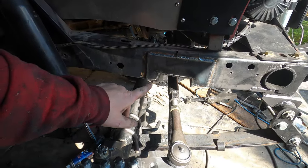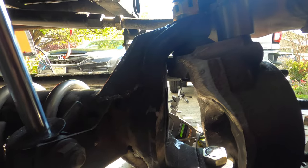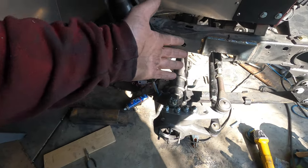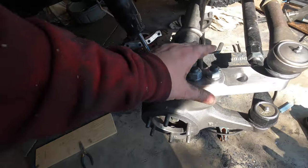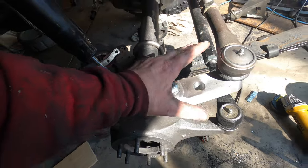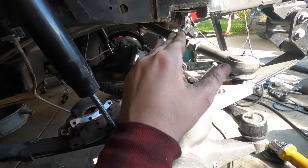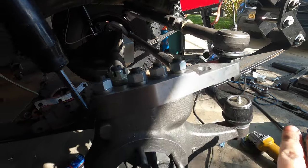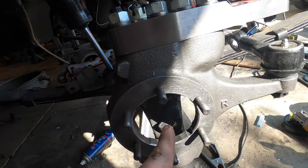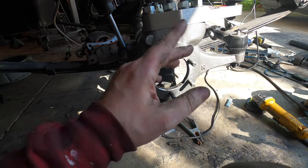We need to clean up the rest of this notch out of the frame. I think we took enough off the knuckle — we had to take a lot off again. Even without shaving it for RCVs, you can see how close it is in there; it actually wasn't fitting to turn with just the stock knuckle. So for whatever reason with this Jeep Wagoneer axle, that new aftermarket knuckle wasn't going to fit stock. The cool thing is this material isn't too hard to get through. We drilled that out for the tie rod and a 7/8 sleeve. This part of the high steer arm is already drilled out for a Chevy one-ton taper. We have pretty much everything torqued down except the drag link and jam nuts. We've already cut the threads off the ball joint there and got the studs pressed in. Really, we can start putting this back together — starting with the RCV axles.